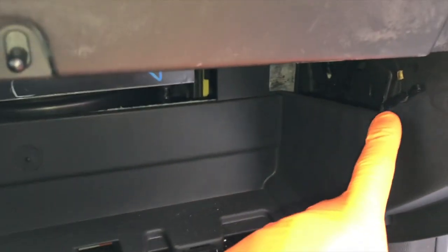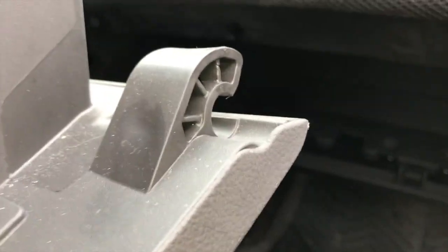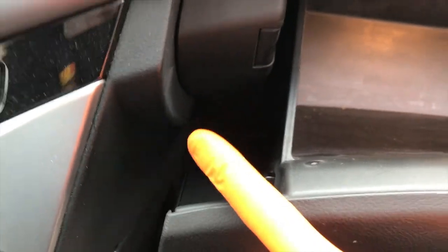Just like that. One last thing prior to grabbing the glove box — this is that tension rope. When you insert the glove box and secure those clips, make sure you do not trap this rope inside there — that would not be good. On the bottom portion of the glove box you'll notice circular cutouts, one on the right side and one on the left side. Those go inside the inserts here, loop around, and that is how it rotates — so line those properly and apply some pressure to insert those circular cutouts onto the part.